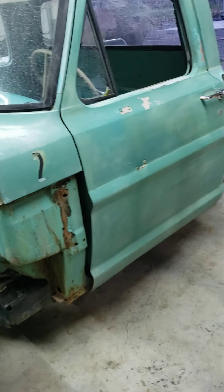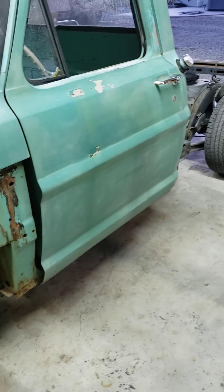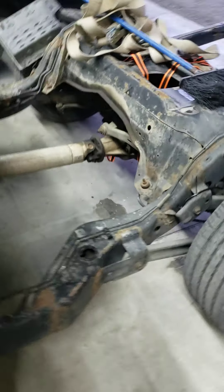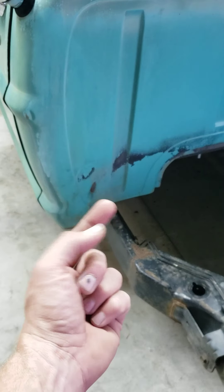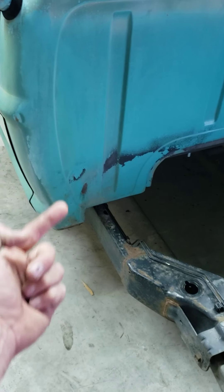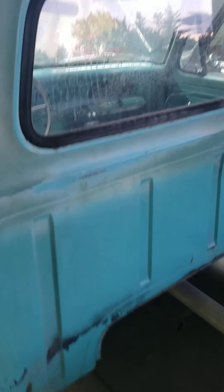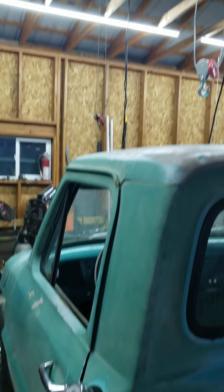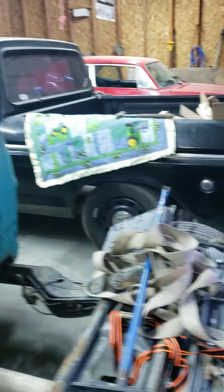The Mill Truck cab does have to come off one more time so that stuff can be painted and some welds on the back cab support can be done up. Also, the back cab corners need to be notched to fit the Crown Vic chassis, and that seam has to be sealed — otherwise it's just an open pocket. But as I said in the last video, that's no problem with the cool winch setup. I have the smaller winches set up on front to raise the whole clip up and down so I can do test fits and move things around all by myself.